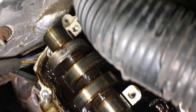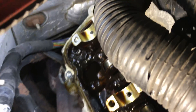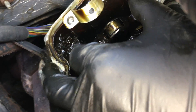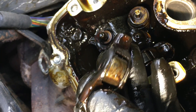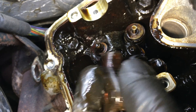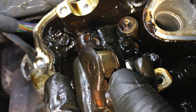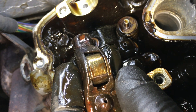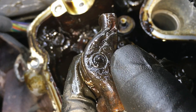I'll pull this cam off and look at the roller follower to see what condition it's in. Let's get in here and take a closer look and show you guys what it looks like. Pull that bad one out — you can see it's all chewed up. It won't spin anymore. It's got a flat spot right here — see that flat spot? That's where it locked up and then the cam just drilled into it and made it flat.